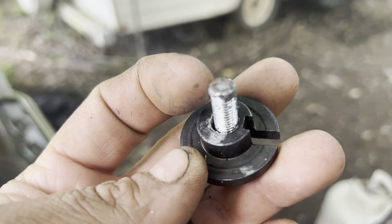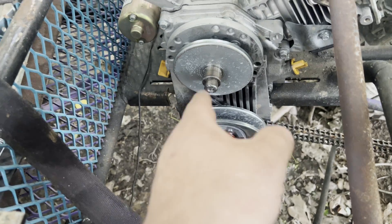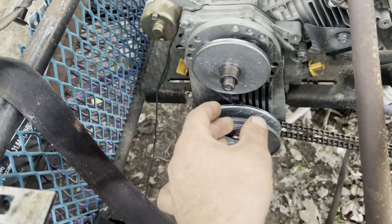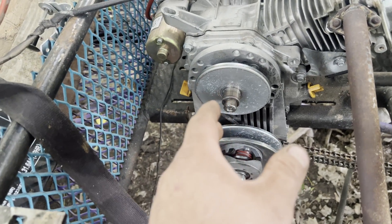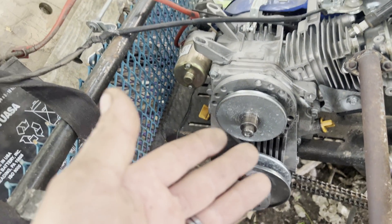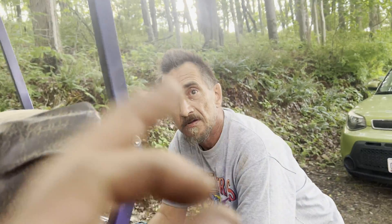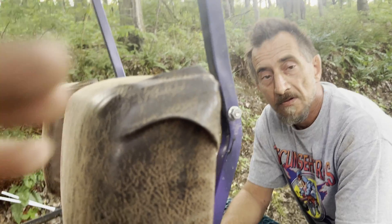He broke the bolt off straight off, but the bad part is it's kind of my fault because it wasn't the correct bolt. When I was in a hurry to put this together, I cross-threaded it in there and kind of brought it out here. It lasted a few weeks and quite a few miles, but we were hard on it too. The thread was just a little off, but it's enough to where you can't spin it out.